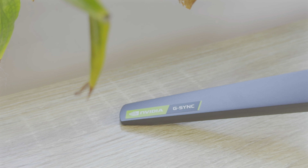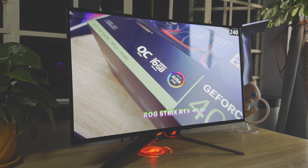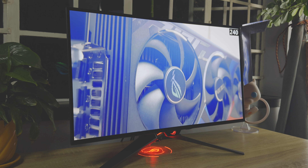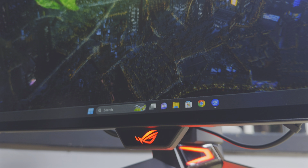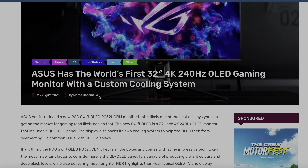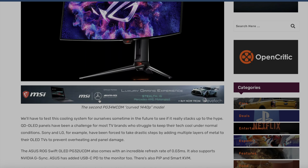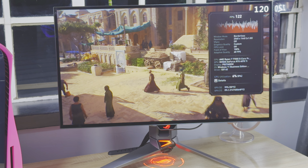From a technical point of view, this monitor is one of the best displays you can get. But I still kind of feel robbed. The overall HDR brightness isn't that great, meaning the custom cooling system still isn't up to standard to pump out the brightness seen on other display technologies. OLED is fantastic, but brightness limitations are still a tough pill to swallow and this display definitely has them. There's also no USB-C, which would have been the cherry on top at this price. The elephant in the room is the new 4K 240Hz model expected in early 2024, which aims to increase brightness thanks to its graphene film — making spending 35,000 rand on this model a little difficult knowing a better version is on its way.